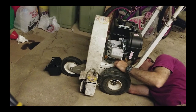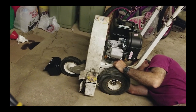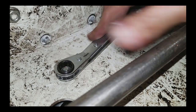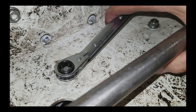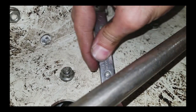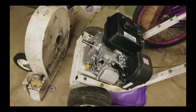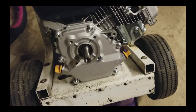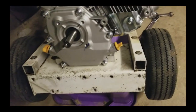You don't want to over-torque — you don't want to break the crankcase. The next fun part is to put the blower housing and the impeller on. Unfortunately these have to go on together because the shape of the impeller is such that it will not fit through the rectangular opening except at an angle, which means there's not enough room to get it onto the crankshaft. I'm going to have to line these up together.